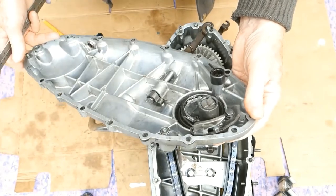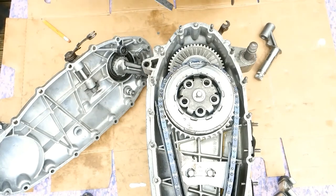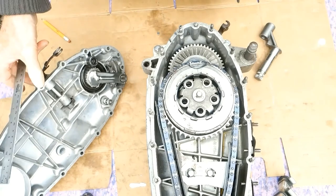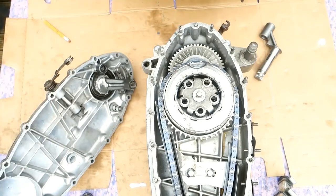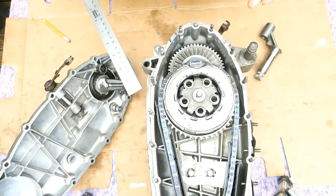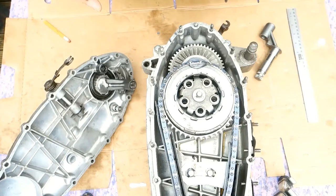I've now measured from the top of the teeth to the top of the rim — 37mm, the same as the rim to the cogs. The teeth are touching the cogs. A 0.5mm gasket will give me 0.5mm clearance — best case scenario. 0.5mm of travel for the gasket, 2mm of travel for the teeth to mesh with the cogs — a total of 2.5mm of footboard travel, or 15mm of pedal travel.